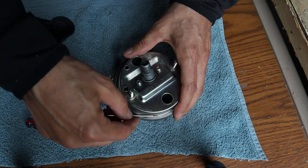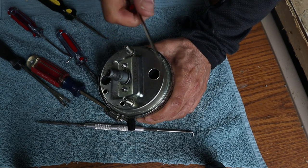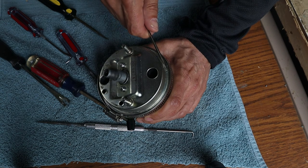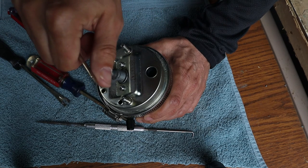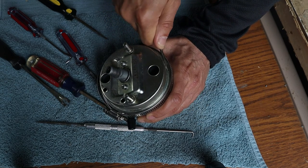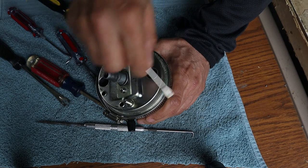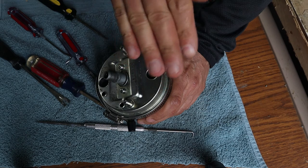I think I found a method that's sort of working. I take the screwdriver so the blade is parallel to the vertical part of the speedometer case, get it in there, and kind of turn it almost like I'm tightening a screw so the bottom edge of the screwdriver gets under the lip. I just turn it a little bit, watch it bend up a little, and move forward — going slow, not prying everything up at once, just little increments.